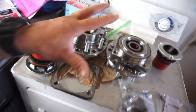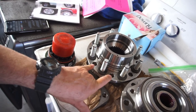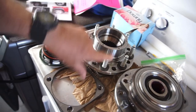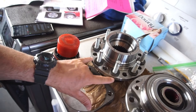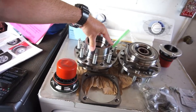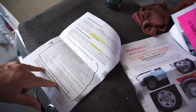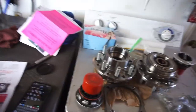Not to mention this is a Ford wheel bearing, so the lug nut pattern is different. This is an 8x170mm pattern and the Dodge and Chevy are an 8x6.5 inch which is roughly 8x165.1mm, so you'd have to have all those drilled out at a shop. Looking at all that, it probably would have cost around $3,000 to make this work. With cheaper bearings you might get it down to $1,700 to $1,800 — no big deal, I'd rather spend the money than try to DIY it.